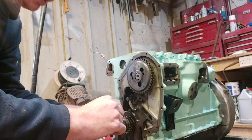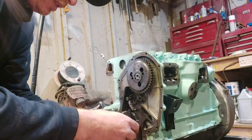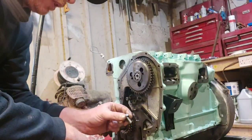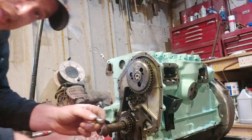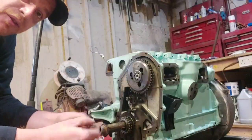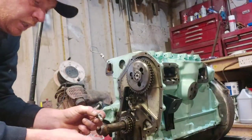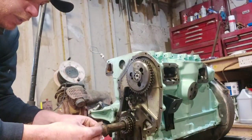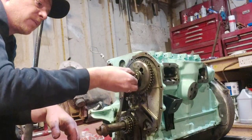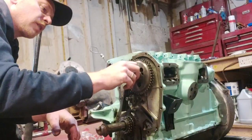So you've got your big washer, and your locking tabs. So we'll slot that on as well. I'm assuming that was an original camshaft, but it's in there. The new camshafts, the thread is different on the nut on the end, so you will have to source a nut for it. This is its one. Luckily, I've got a specialist near me that does every type of nut you can ever imagine. So just slot that in like so.